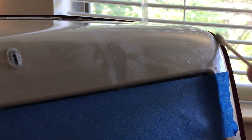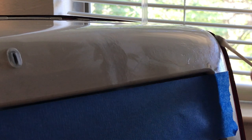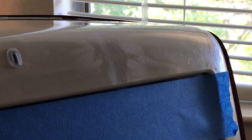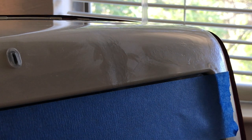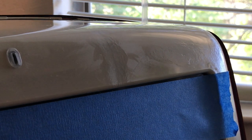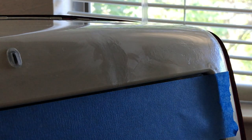Do not get the acetone on the ruby red cover — I haven't tested this. I've got a lot of old Mac parts, and usually when I test things I'll use one of those as a guinea pig. So we're going to let it set just for a couple minutes. It's already dried to the touch there. I'm going to let it firm up just a little bit longer, and then I'm going to use a sanding block on it — a 220 grit 3M sanding block. You can use it on metal, wood, or plastic, and the nice thing is it conforms to whatever surface you have rather than using a rigid piece of wood.